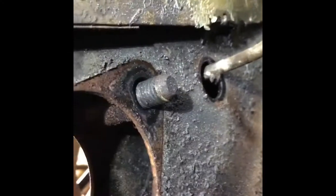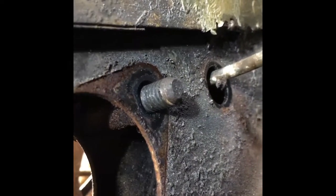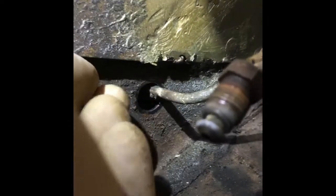There are little sleeves inside that gap that the bolt goes through. If you pull the bolt out, the little sleeve will fall down — so by leaving the bolts there, they will stay in their happy place. You've also got to get the boot off of there because it's still stuck on the other end. I'll clean this stuff up before the new master goes in, and maybe get a little coat of paint around here too to neaten it up.